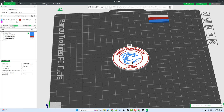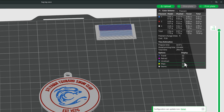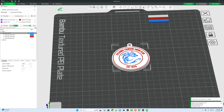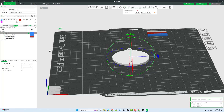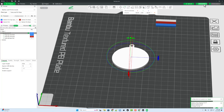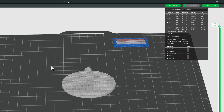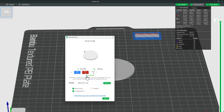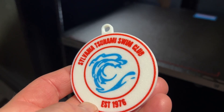I did the same thing to load the flush one, and we're going to print it face down. I'm going to slice it first — notice it's going to take 29 minutes. We're going to go back to Prepare. A lot of people like the face-down print, so we're just going to swap it — hit Rotate and flip it 180 degrees so it's face down. When we hit Slice Plate again, the same project takes about 31 minutes. So we've got two more minutes of print time, but we get that awesome face-down print. Simply hit Print Plate, double check the colors, and send it to the 3D printer. And 30 minutes later, bag tag created.